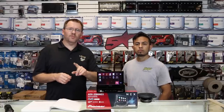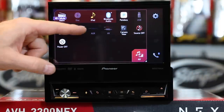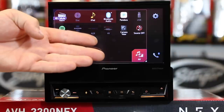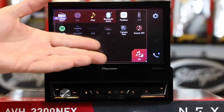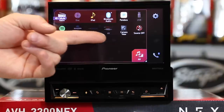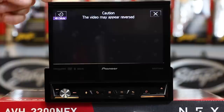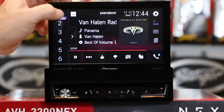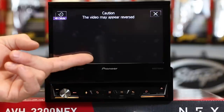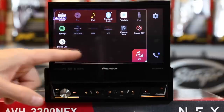There are a couple more features to talk about before we get to Android Auto and Apple CarPlay. As we said, it'll do Sirius XM with the extra tuner, it has an AUX input, it has an AV input. The AV input is useful if you want to use something like an iSimple Media Links to get an HDMI into this radio, because it doesn't have one natively — we do have a video on how to get HDMI video into your new NEX. Camera view — just like holding the button down, this will automatically take you to camera view. Once you're in camera view, you can touch the screen and do whatever you want, and then 10 seconds after you've last touched the screen, it's going to flip back to camera view. If you don't want it to do that anymore, select the X.